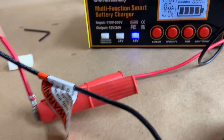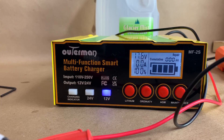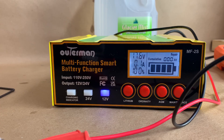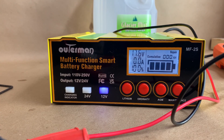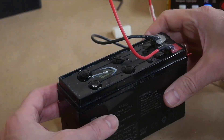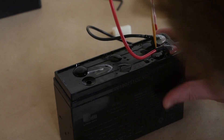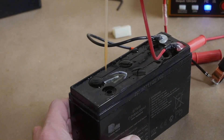After the cells are full, I put the battery on the charger. You can see it's not taking charge at this moment — zero amps. But after 24 hours on the charger in maintenance mode, it should take charge. After a couple of hours I also used my stick and pushed on the sides of the battery to extract remaining air from the cells.